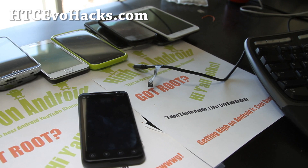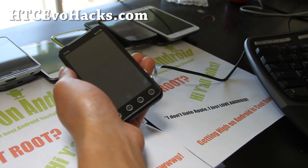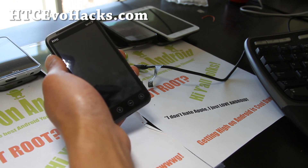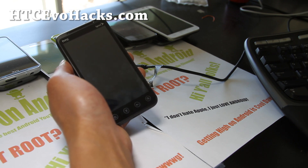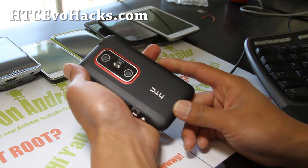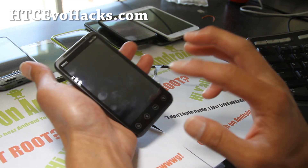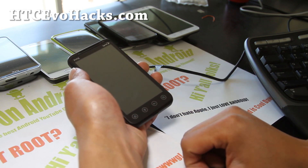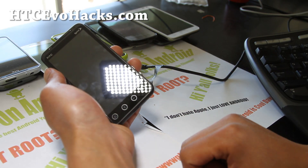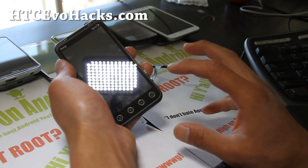One more note about the installation of this ROM or any ICS ROMs: we found out that if you have S-on and try to install ICS, you'll have to try to Google for the Anthrax kernel to make it work, but some of the stuff is broken. My best recommendation: if you want to install ICS ROMs on your Sprint CDMA Evo 3D — not the GSM, the GSM works fine and you don't need S-off — but if you have the Sprint version, you need to get S-off. If you're S-off on Hboot 1.50 and did the wire trick, you still need to boot recovery from fastboot to make the ICS ROM run without a boot loop. If you're on Hboot 1.50, S-on, I don't recommend flashing any ICS ROMs anymore because the Anthrax kernel isn't supported — the developer just gave up on it. So I don't recommend it. Just get S-off.